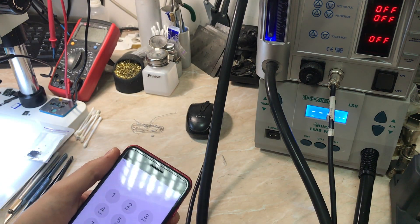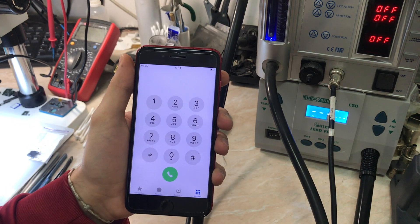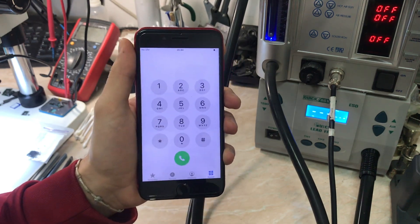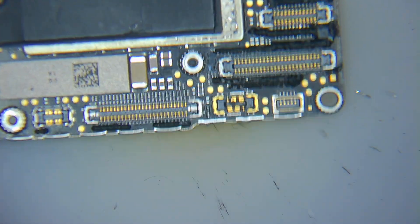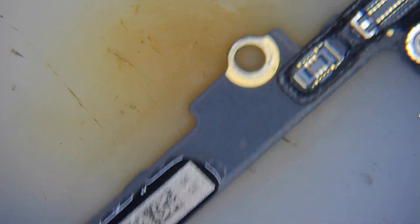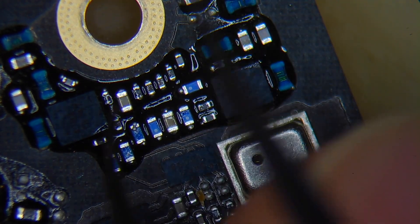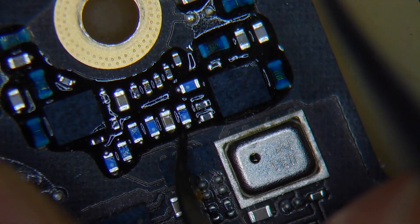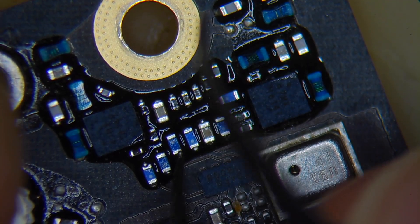So I guess it is a problem with the modem or the WTR, which is a very common problem with the iPhone 8. We are going to remove the board, do our diagnostics, and see if it's the modem or the WTR. Here under the microscope — the board is removed from the body. There's a little damage on the M5500, which is not going to be a problem. After a bit of heating, there are balls that came out from the underfill of the UAT tuner elements, which handle the GPS and network antennas.